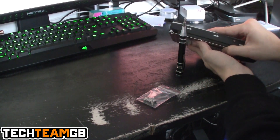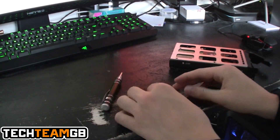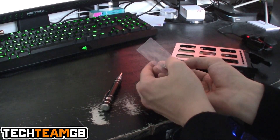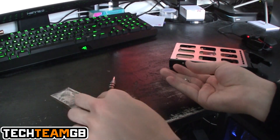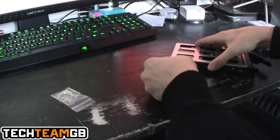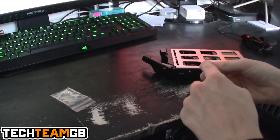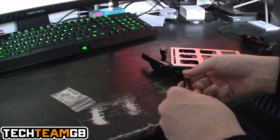To put a hard drive in the sled it isn't tool-less — you will need a screwdriver. Just line up the four holes on the side. For this video I'm only putting two screws in diagonally so it's secure, but at home I'd definitely recommend putting all four screws in, just in case drive vibrations loosen them and the drive falls out.